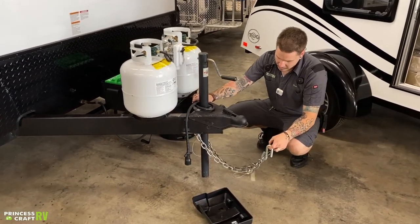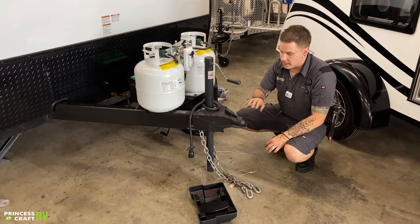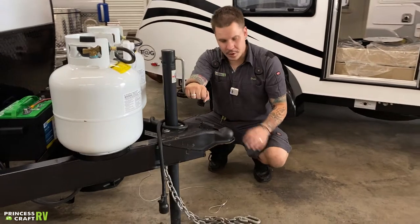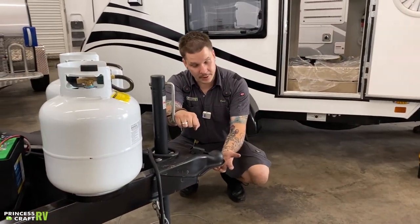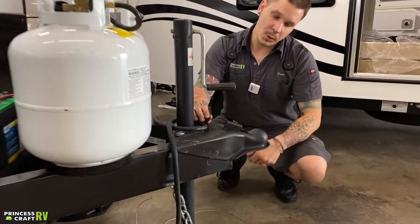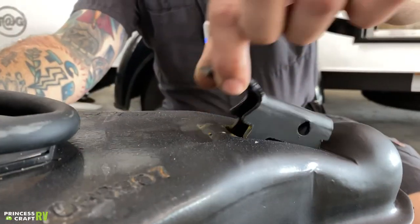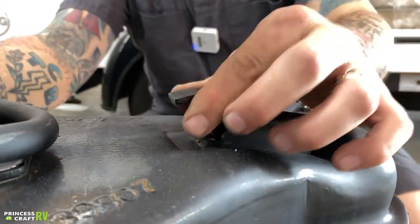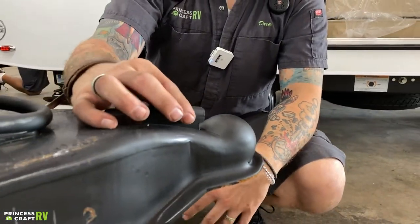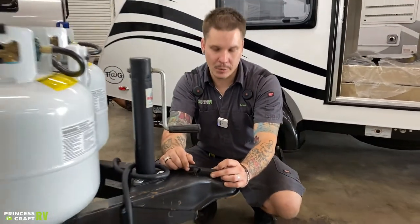Before doing that, you're going to start with the loading and unloading process. You're going to crank this up three inches above your ball and drop. Go ahead and center yourself underneath the coupler, then lower this down. Once you are fully seated on the ball, slide this forward. Pay special attention that these two vampire teeth are fully engaged in the frame and resting flush. Go ahead and take a secondary pin and pin that mechanism back — that's added protection to keep it from potentially rattling loose.